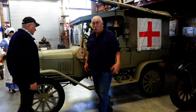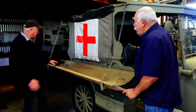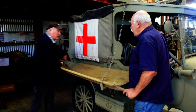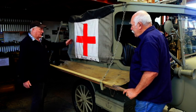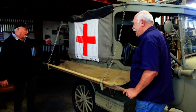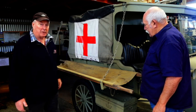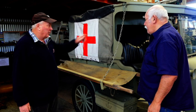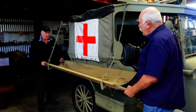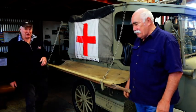Let's go to the other side and have a look at the controls. The stretcher sits on the side here, Roger — so there's a reason for that? Yes — they would lay the patient on here, head up this end, feet down here, because the bodywork was so short they couldn't slide them in the back. Later on during the wartime they extended the bodies another two or three feet — the wheelbase was the same — a bit like a seesaw, and they put patients in the back. But in the early stages, there's a chain here that collapses up and goes back on top when traveling. The nurse here would talk to the other patient on the other side, and once done, you folded it all up — simple, very easy.